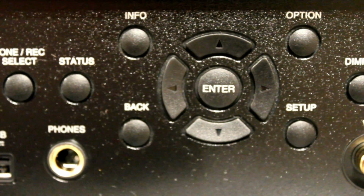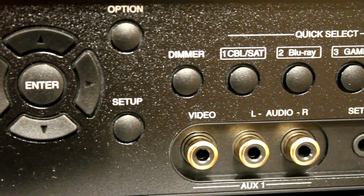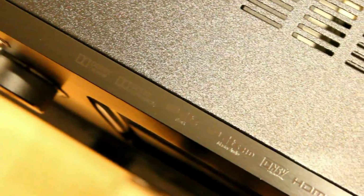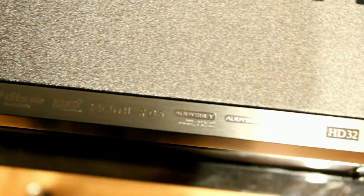So you can run a HDMI cable off to another room and it will do the sound and picture to that room. It will also, interestingly, with that, pass through True HD or whatever you're using in it. So in theory, you could have another home cinema amplifier on the end of that HDMI cable and share the high quality Blu-ray player or something that you've got attached to this receiver.